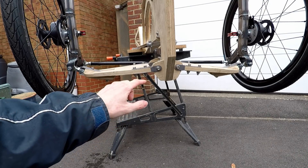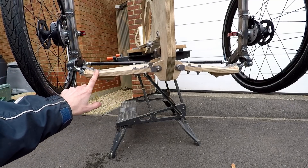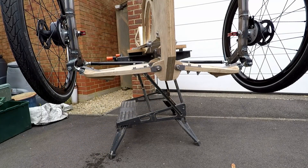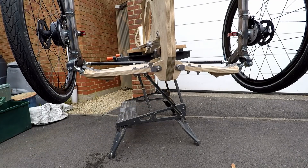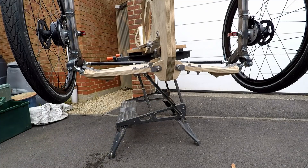The other thing to point out while we're down here is these brackets which hold the ends of the wishbones. I'm going to pass a jubilee clip all the way around there, drill a hole through the body front and back, just to make sure that those don't come off. Because they're glued on and they're pinned through with a wooden glued dowel, but my confidence that those aren't going to come off is pretty low. So by putting that strap around it that will hold those nice and securely.